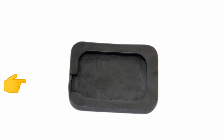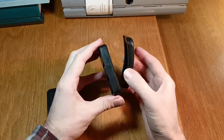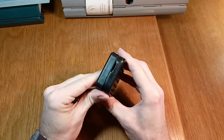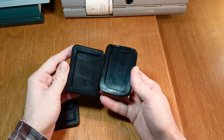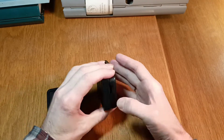It's also important to say that the 140 series original rubber parts for the clutch and brake pedals are different and not interchangeable. The 140 series has a little cut-out on the rear of the lip, special for the pedal leg. Comparing our pedal covers, they are different — so we can't use a non-original part for the 140 series because this part has no leg divot in the lip.